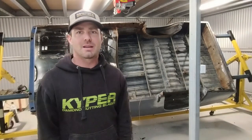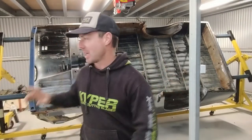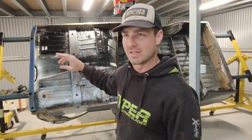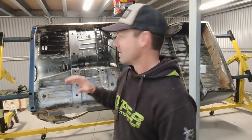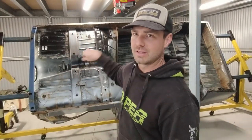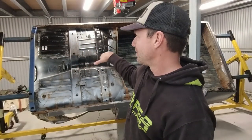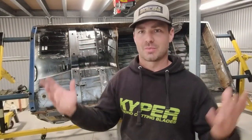The other thing I'm going to try and do is the underneath. At the same time I'm tackling the cowl panel, I really want to try and finish the underneath and inside of the cab. You want to get as much dusty work out of the way so it doesn't land inside that cowl plenum chamber and you have to constantly clean it out anyway. Before I weld it in, I want to treat the underneath with KBS, clean and vacuum the inside of the chamber, weld it on — that's the plan.